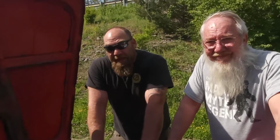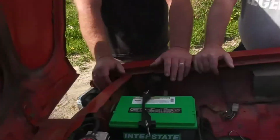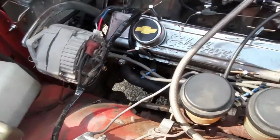Fought with them, so I got with Fitech and ended up going with the Fitech 400 EFI. It is rated up to 400 horsepower. It is plug and play. You can literally put the kit on in a matter of hours. Start it up, it learns itself as you drive it. No tuning required. I've driven it 7 or 8 times and it has fully set itself over that period of time.